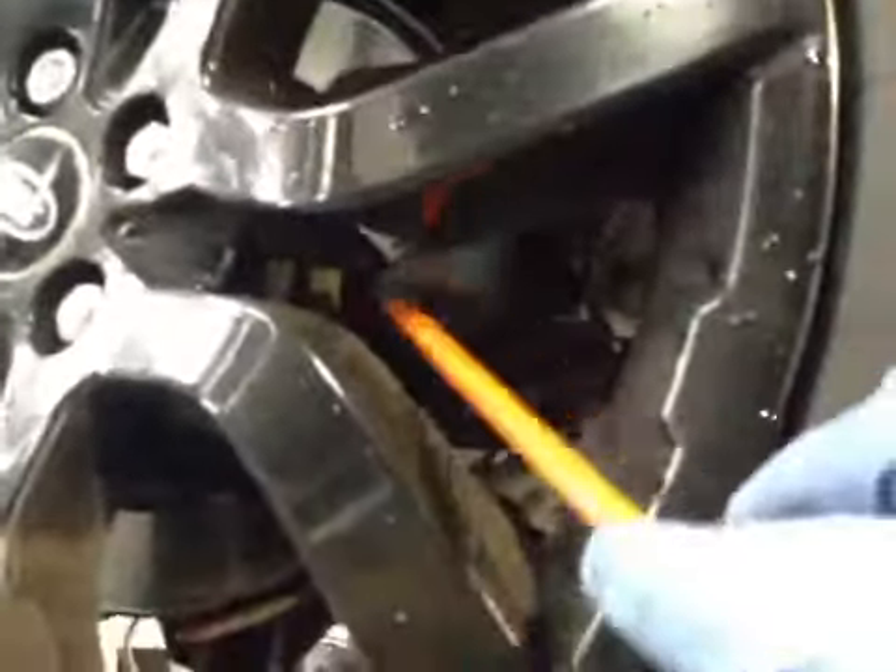This is the passenger side rear suspension — all looking okay. Passenger rear tyre is in good condition, it's green on the health check. No signs of wear on the inside of the tyre. Rear disc is in okay condition. Your rear brake pads are roughly on 4mm, so the pads are in amber, discs are in green. The tyre is green.